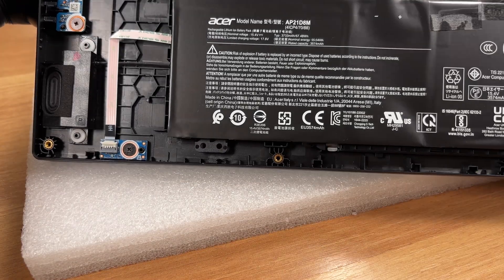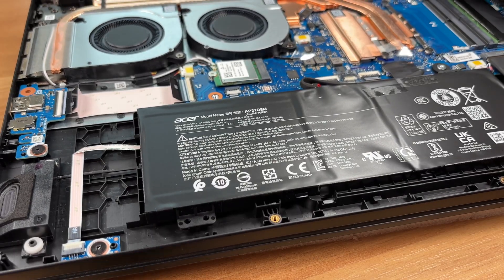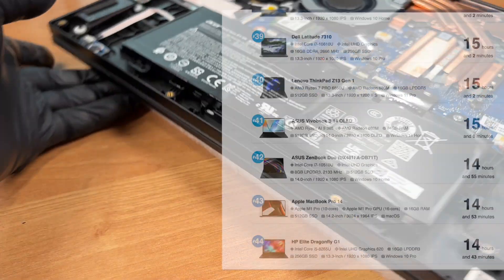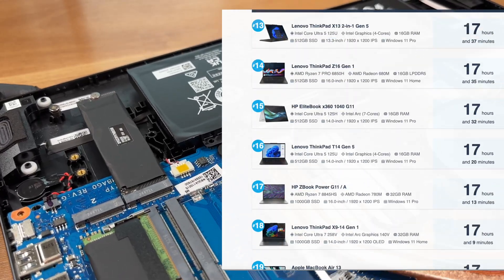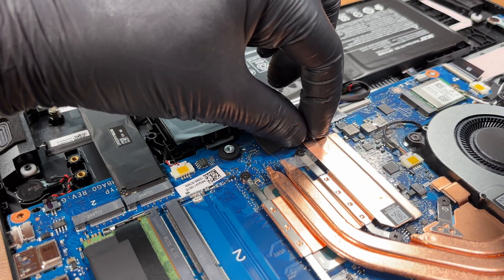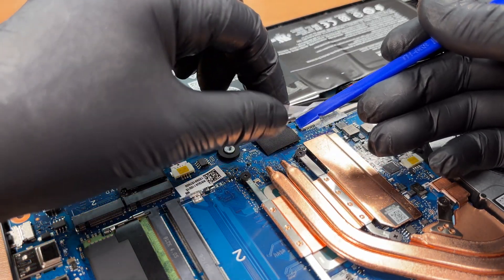The battery is a lithium polymer pack, rated at 57Wh and 15.4V. Some versions of this laptop ship with a larger 76Wh unit. The battery isn't screwed down — it's held in place with adhesive and alignment pegs. Don't forget to visit our top 100 laptops with the best battery life ranking page. Lift the tape to reveal the battery connector and unplug it with a non-metal tool before working further. You can check the result of our battery life test on LaptopMedia.com, the link is below the video.